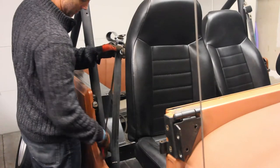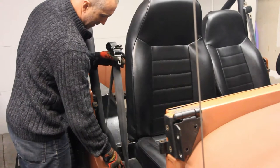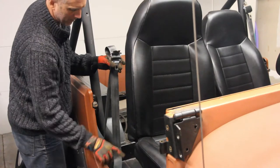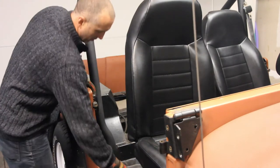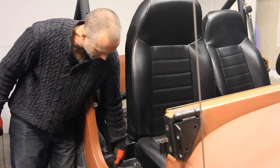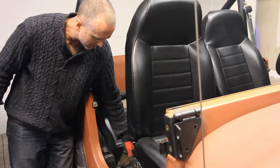It's a three-point seatbelt. You've got one point here that goes into the side panel, then you've got the main bolt that bolts through the floor pan down here, and then the one that's up here. You just need to take off this one, and then there's a bolt directly underneath here that screws right into this piece that you need to take out.